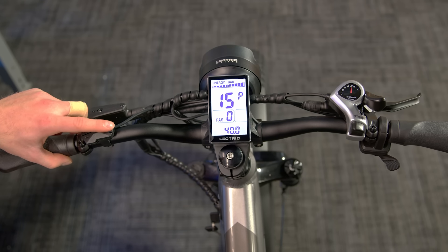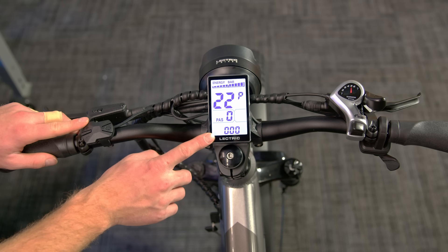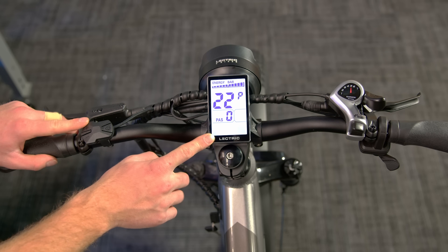Your XP will come stock with the throttle capped at your pedal assist setting. However, this can be changed via page 22 of the settings. On page 22 of the settings, having the setting at 0 will limit your throttle speed to the level of pedal assist you are in, meaning that in PAS 1 and 2, your speed via the throttle will be capped at 9 miles per hour and 15 miles per hour respectively. If the setting is set to 1, you are able to go up to 20 miles per hour in all PAS settings, but throttle assistance wattage is limited by the PAS level. Finally, if the setting is set to 2, you will have the full power of throttle no matter what pedal assist level you are in.